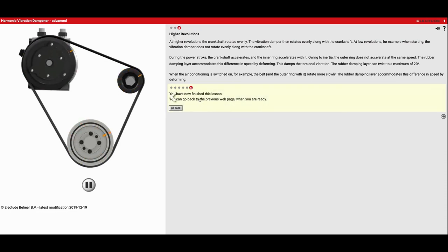Now we've finished our module on the harmonic vibration dampener. One thing I want to point out: these things do go bad. That rubber piece just wears out — like anything made from rubber, it finally cracks and gives up. This piece may need to be serviced every once in a while; typically they last the life of the car, but it is common that they wear out. So if you have an engine vibrating really badly, or every time you turn on the air conditioning it's squealing, you'll want to check the belts and also make sure the harmonic vibration dampener is spinning the way it's supposed to. Thanks for getting the module done, and hopefully I'll see you guys soon.